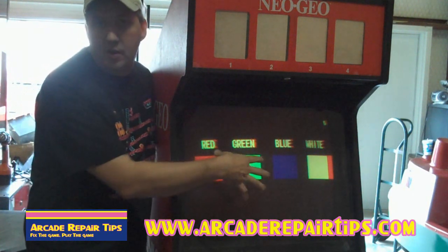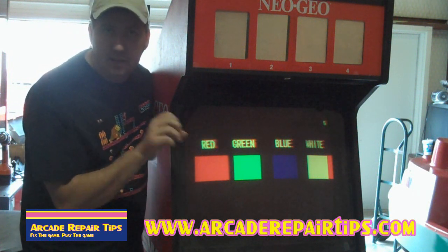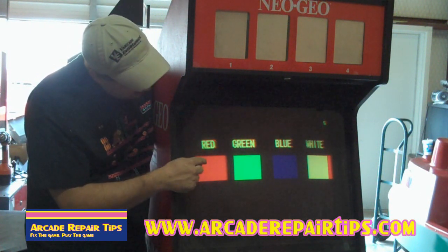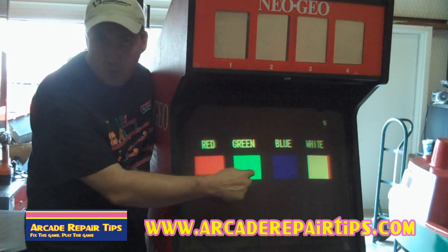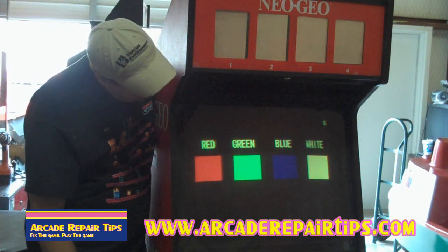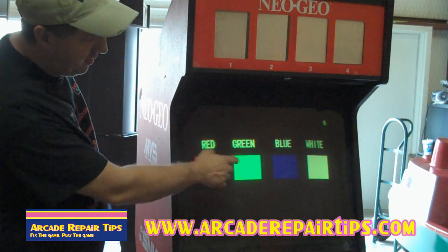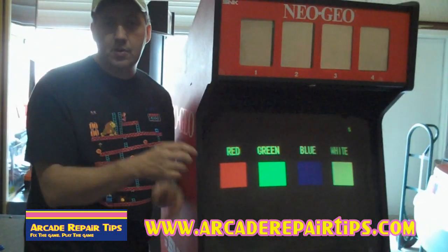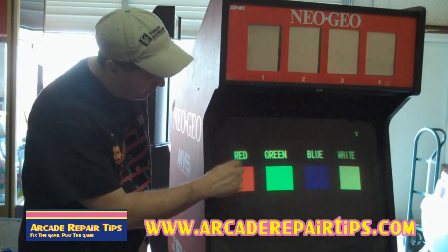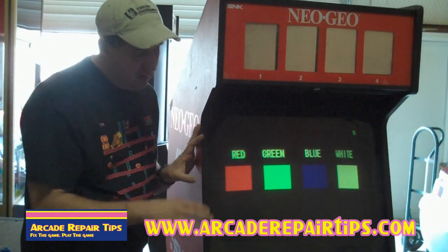Here we are on the color screen in the test menu. As you can see, the red right here — what we call bleeding — is coming out of the white. I'm going to turn the red drive down some and watch this go in as I do that. See how it's coming in, coming in. It's looking more like the other squares now. A lot of monitors will show a bar instead. A little bit more. There we go — we have fixed that color bleed. So you have a red drive, green drive, and blue drive on the back of your neck board. As those were bleeding, you turned them down to bring them in. Look for those especially where you see lettering — if you see colors bleeding out from there, you know it needs adjusting.